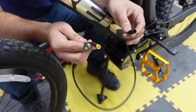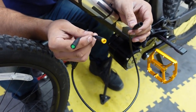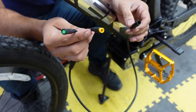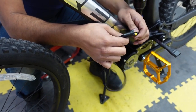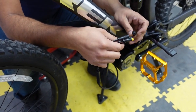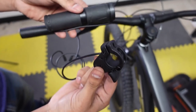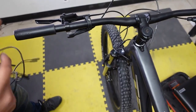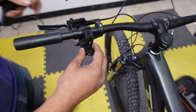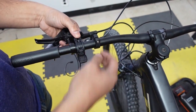Now plug in the main wiring harness into the controller. There are two plugs coming out of the harness: the yellow one is for the throttle and the green one is for the display. There's also an option to get a wiring harness with four plugs — the two extra are for the brakes. Time to install the throttle — you have the option of a thumb throttle, half twist, or full twist. We're going to install a thumb throttle and use a three-millimeter hex to tighten it up.